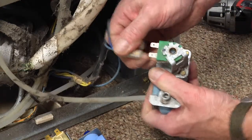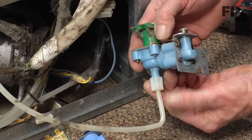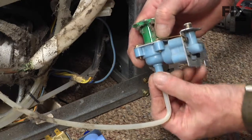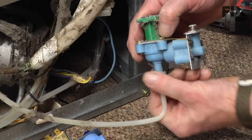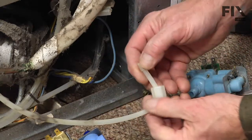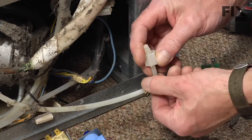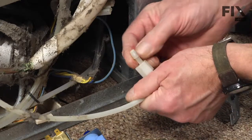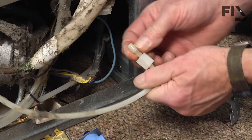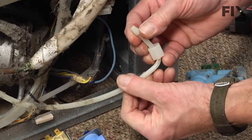First step will be to remove the wire harness and to carefully remove the nut that holds the outlet tube on the bottom. Now if it's a preformed tube on your model like this, be careful not to overbend that elbow, and it will have this arrowhead shaped end on it that should be smooth all the way around. If it's not, you'll need to replace that tubing.